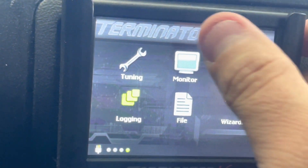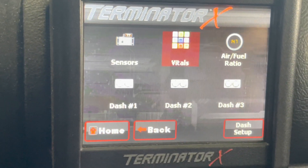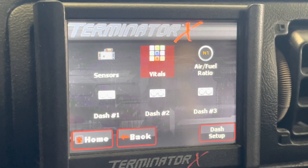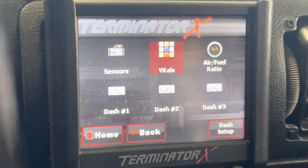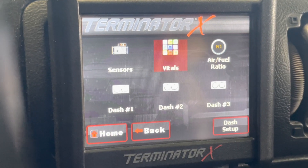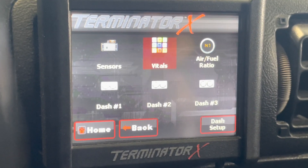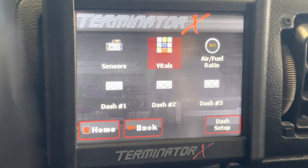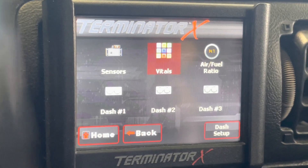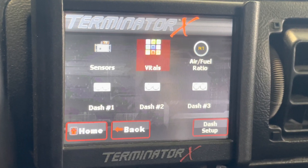One other way you'll know that everything's good is when you're going through the screen, you'd get a message on the bottom saying it needs to be updated. I have to update my 7-inch dash, so I'm going to make another quick video on that. This is all in order to use a CAN expansion module. On my particular Holley, I have used all four input outputs, and I'd like to try to get a little bit more out of this Terminator kit before dropping the money on a Dominator. So that's what stemmed this firmware update. I've got a video on that SwapSmart module and process coming out soon. If you've got any questions, make sure to ask. If you want to see more, make sure to subscribe. Thanks.